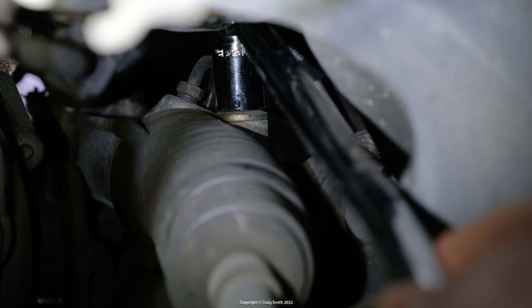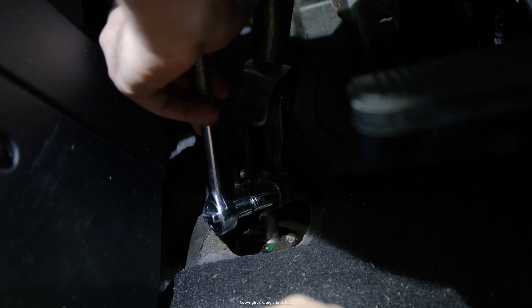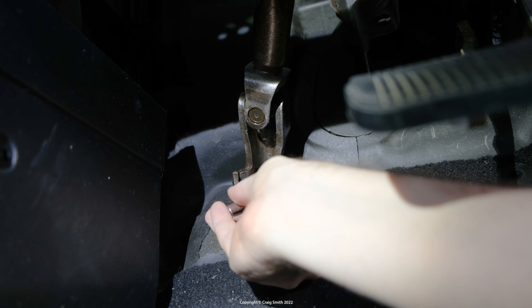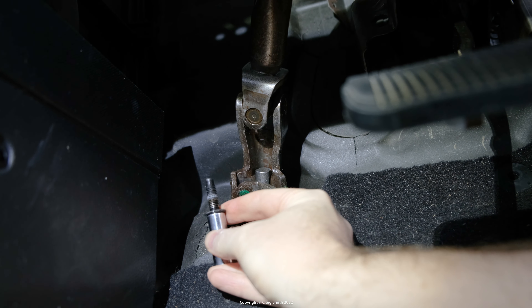The rack is connected to the steering column via a coupling which is totally inaccessible to start with, and even if you could magic it apart somehow, the column side of the rack still sticks up enough that it wouldn't allow the rack to slide out unless it's lowered down quite a lot. So to start that process, the first thing to do is disconnect the flexible steering shaft inside the car. It's just a small hex bolt — it might be quite tight, so use a good quality socket and remove the bolt fully. Once out, the shaft fitting is hinged and rotates away from the triangular stud, and now the rack outside is mechanically disconnected and can be lowered.